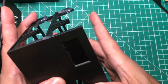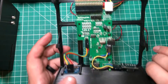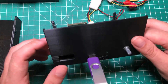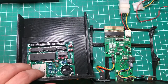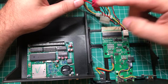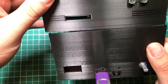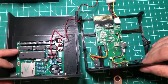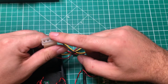It's heavy duty, and when I'm pushing the SD card in, it's not flexing like the thin Thingiverse enclosures. I also have the modular style for the GoTek. I have a GoTek in here, and because it's really hard to get drives in and out of the Model 4, I like to use adapters so the power of each unit is completely separate. I can disconnect the power from the machine by crimping onto the five volts — this board needs five volts and uses a normal floppy cable. I crimp on a splitter so I can have the two units together, put one on top, one on the bottom, and completely disconnect the power to get them out. Basically I just rig up my own power connectors.